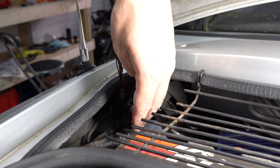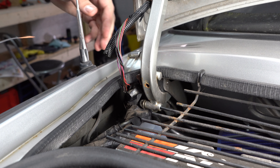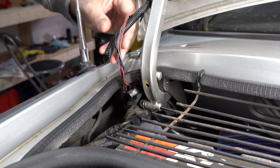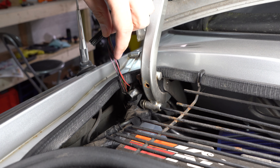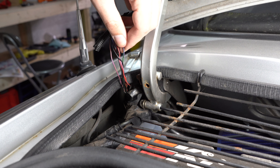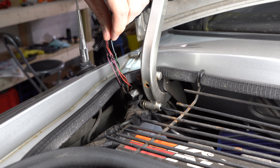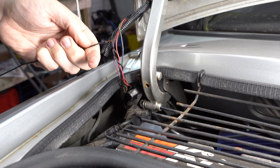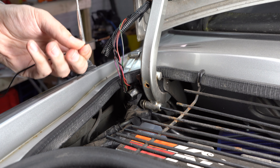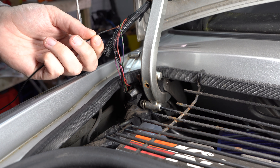I've pulled the wiring down further up just to bring these wires up slightly, and I've also taken them out of this sheathing a little bit just to give me better access to the point where a few of them are broken. I'm going to cut this green one, which appears broken — well, not broken, but the sheathing is broken. I've got some similar, what appears to be similar gauge wire here, and I'm just going to compare the wires to make sure I'm replacing it pretty much like for like.